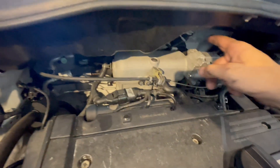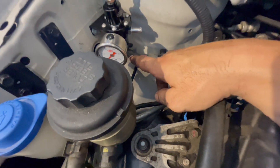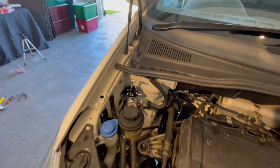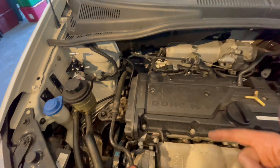The fuel rig is now installed right there. I'll quickly show you how the lines should go — I'll run them at the top here, keep them away from any harm. Bottom is the return line, side is the feed — pretty straightforward. The vacuum line goes here, but when you dial in the base pressure you actually remove the vacuum line first, dial it in, then plug it back in. The original engine bay had a fixed regulator, but we'll still plug it up properly.